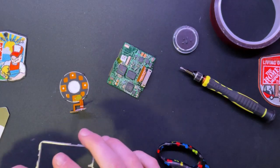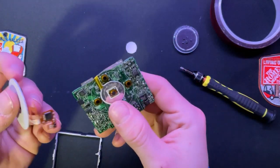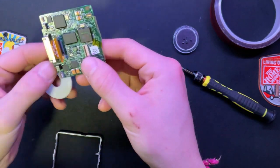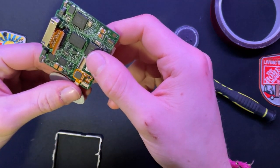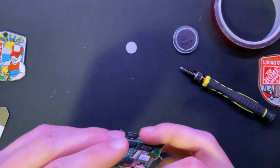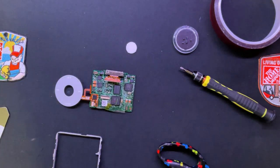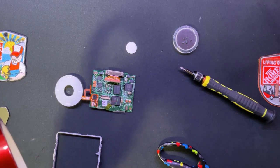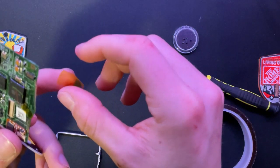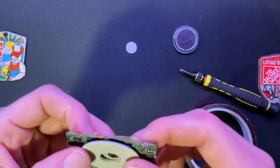I'm not sure if I'll use adhesive for this - I probably won't, I'll just mess around and see. It pulls up on the board while it's in there, so I'll probably have to use it. I'll put kapton tape on it - that should be fine, just to cover the broken points so they won't be conductive. Probably won't be taking this click wheel out again, so it's holding alright - not as well as it should, but that works.